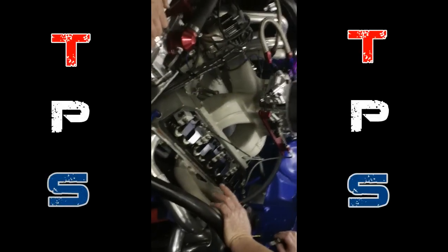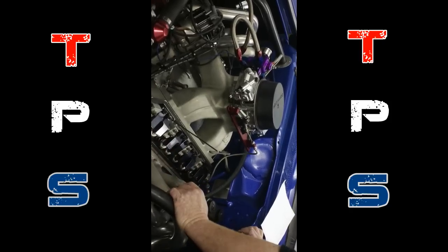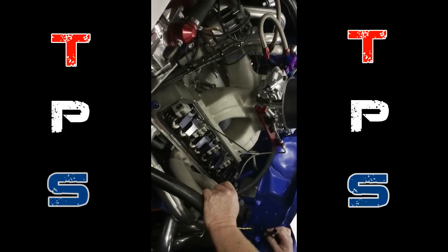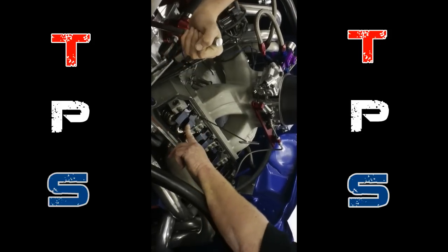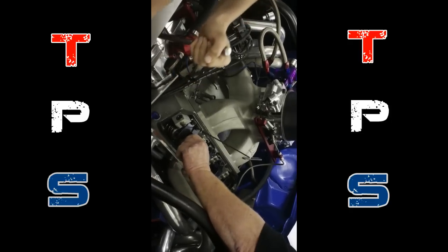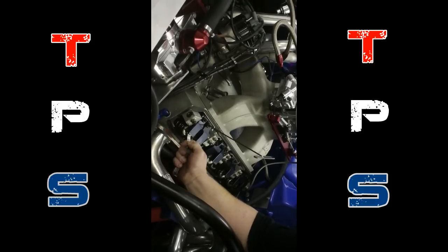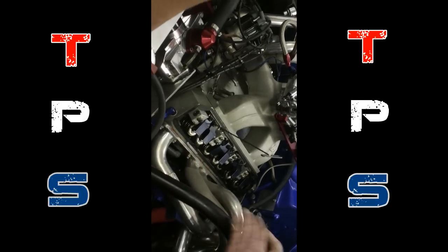What we're looking for is we adjust the intake when the exhaust is just starting to take up the lash before it starts to open. So we got to watch carefully here. Okay, now this one here, the intake is almost all the way opening. Now we're going to go ahead, keep going, Ty. Okay, now we're going to adjust this exhaust. We want to stick this in, make sure it goes in pretty tight, which it does. That one's good. We're going to leave that one alone.